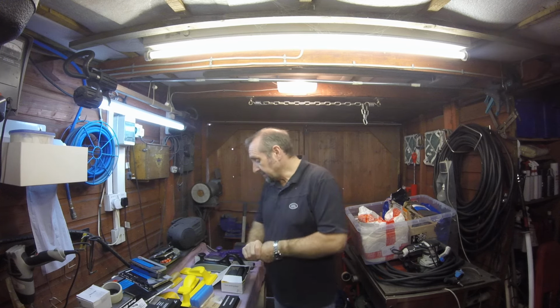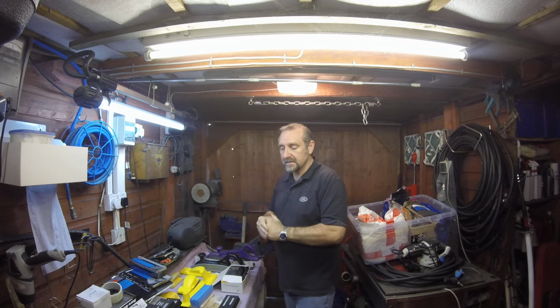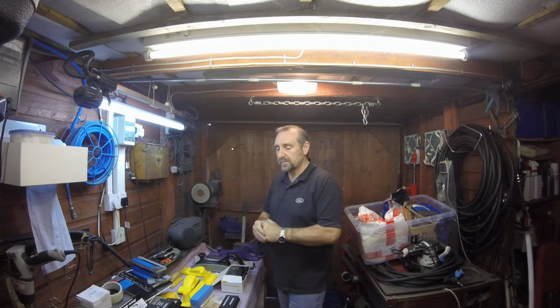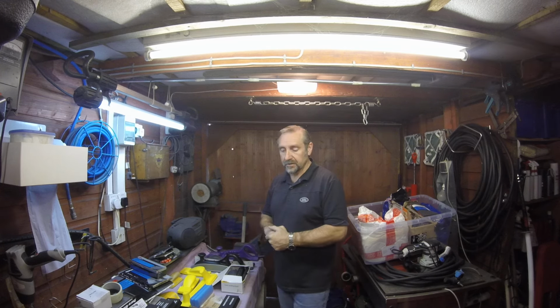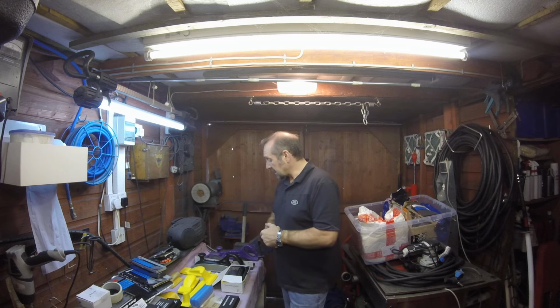That's about it really for hand sanding. As I say, hand sanding is more for detailed work where you want to create a final shape, a nice sharp line in a filler repair or something. Machine sanders just aren't that capable of creating a shape.